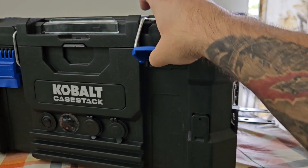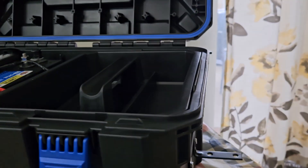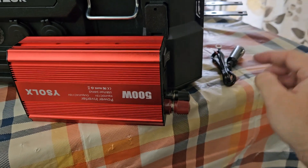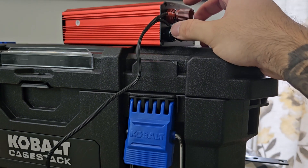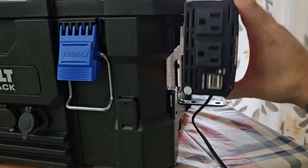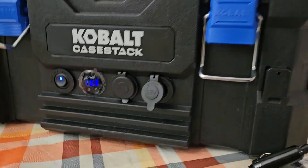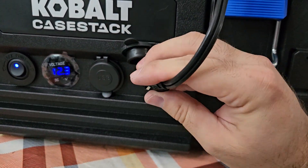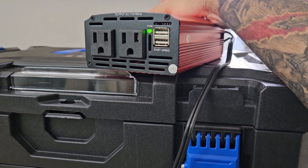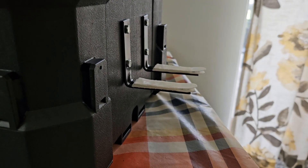Now I'll show how I intend to use the inverter — I'm not going to permanently mount it because it's easier to hook up as needed and it won't risk getting damaged. It fits underneath in the box. Connect red to red, positive to positive, black to black, negative to negative. I realized the cord is a bit short so I'll extend it later. Turn on the battery — voltage shows we're live — then turn on the inverter; it'll show red then green when active and you'll hear the little fan.